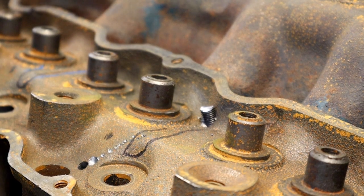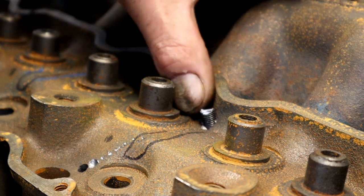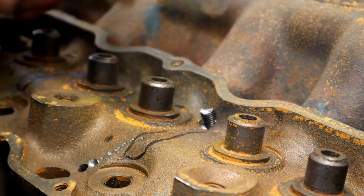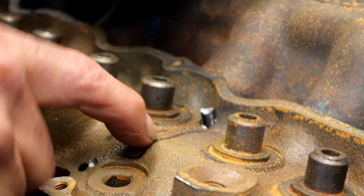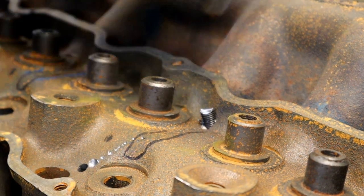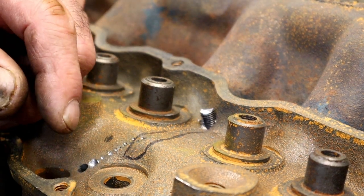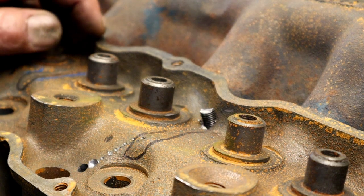Look at there. So, all right, so I put a little gouge in it, so when I come in here and tap it, it'll break off. I know a lot of people that just tighten them up and break them off flush, but they don't go flush. They go underneath the deck. And if we only have a thin wall up here to hold threads, we don't want to lose one thread doing it there. My uncle would also take a sharp chisel and put the sharp chisel right there, hit it, put some indentures in it, knock it off.